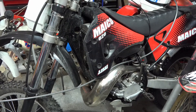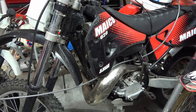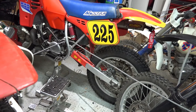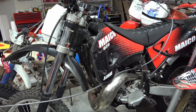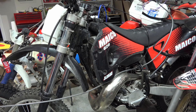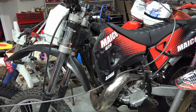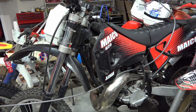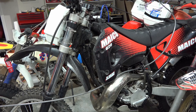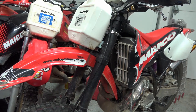In a way, Evans is a workaround because this is a huge, huge bike. It's not that the other bike was overheating - I changed the cooling system on it first before I ever even tried Evans. So if you can, upgrade the cooling system as best you can. Get fans. Then if it's always boiling over and you're just going to ride it like that, then do Evans so you don't lose coolant. That's kind of my experience, because it does not stop overheating. Does it overheat more or less? I couldn't tell - it seems about the same. But it's a 620 - it's going to overheat if you're riding on a hot day on slow single track.